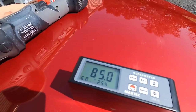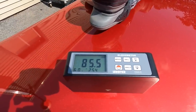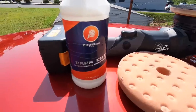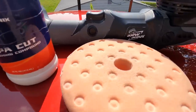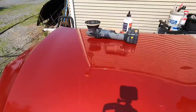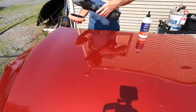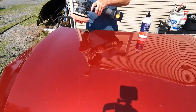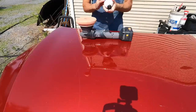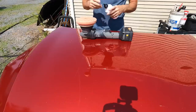So we're starting off in what, mid-80s here? Low to mid-80s. So this is a combination that was in the last video: a safe dimple pad, foam pad, and we're going to use the Pop-A-Cut with a battery-powered polisher, 15mm throw. We're going to have it between the third and fourth speed setting — correction speed — and I'll show you in direct sunlight here.